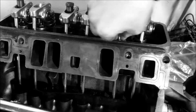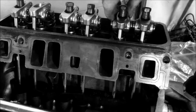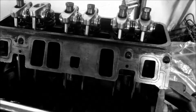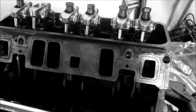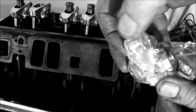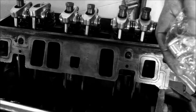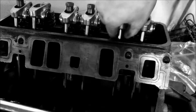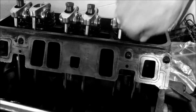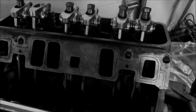Another quick thing — these will spin even after you did your zero lash. That's when they don't go up and down. These will move a little bit. And on the Vortec engine you need to have self-aligning rockers — just really quick to note that. Self-aligning rockers have those little tabs there to tighten it down so it doesn't fall off, because these have no stud plates. The plates are things that go here to hold them — little forks. So yeah, these will move, even when they're under load. Don't worry about that — we're looking for up and down play, not left and right.